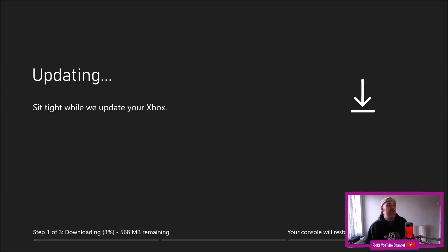I've already tried this before — it got to about 400 megabytes and then ran up with an error. It's come up with loads of E103s and E101s. It's been factory reset about five or six times. I've downloaded the new system software from Microsoft onto a pen drive, stuck it in, and reinstalled the system software on the Xbox One X. It's been okay for about 24 hours and then does exactly the same. So either it's a hard drive issue or there's an issue on the network.